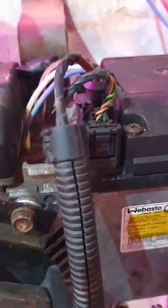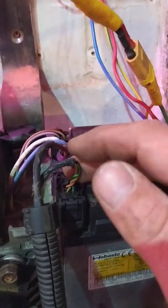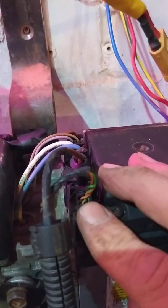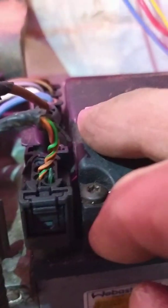That is basically the way they're wired up - well, this one. Some of them are different, but they're usually BMW and Rover which are CAN bus driven. I don't know, don't deal with them, don't like them, don't want anything to do with them. So to recap: pin two, orange and brown, is switch positive - switch it straight to your battery. Black and green is your pulsed output for your fuel pump.